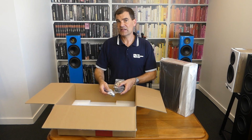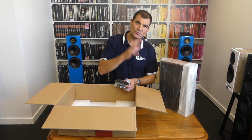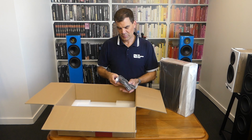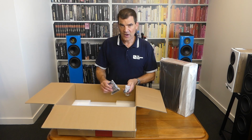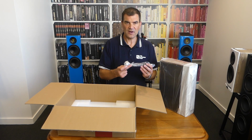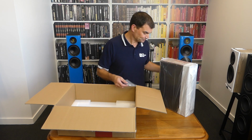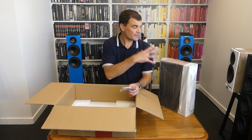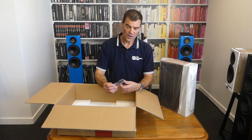we see a couple of really critical features. And I alluded to some of the modern features that NAD have introduced into a retro-styled box. One of the biggest, and by the way, there's the power cord. We'll get rid of that quickly so we're not fussing about it. One of the biggest is its Dirac features. It supports Dirac Live. And with that comes one of the Dirac microphones and a big long cable with a 3.5mm mono connection. There's a second bag, and that's where there's a USB to 3.5mm adapter, allowing that microphone to be connected and control the amplifier itself, along with two Wi-Fi aerials.